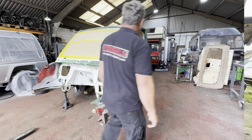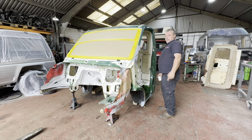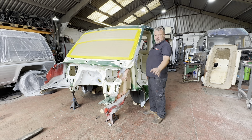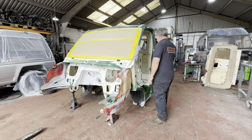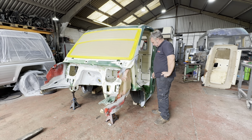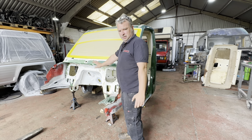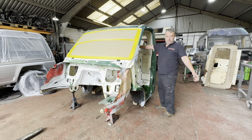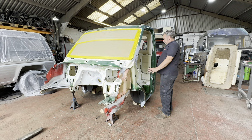Bank holiday Monday — what would you do? Prep a cab. This needs to go Milano red. It's all fixed — seals done, front changed, windscreen panels adjusted and straightened out completely, it's masked up. I've primed the bare metal pieces in here as best I can. Now I need to paint the footwells, the door shuts, and the cabin sides rouge, and then I'm going to do all this red too just to doubly protect it.